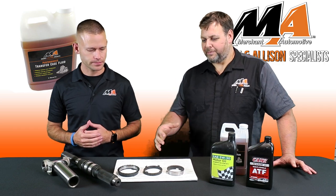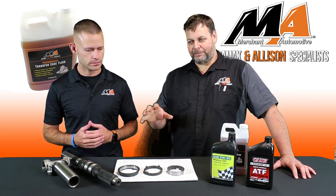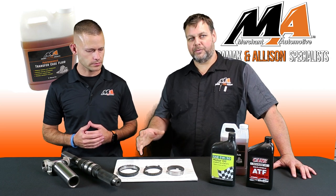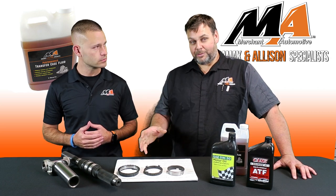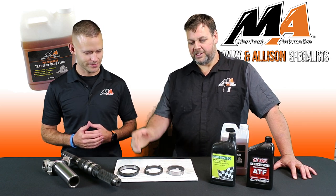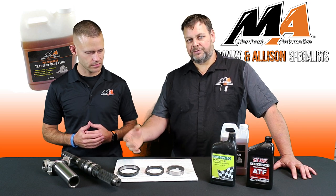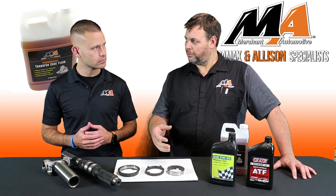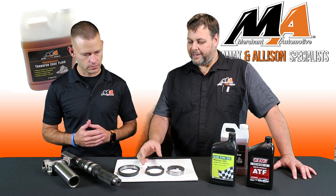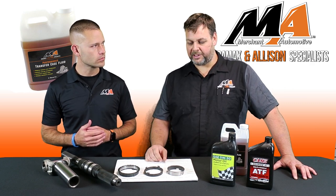Well, 5W30 is great for engine oil. A transfer case and an engine are very different machines. A lot of moving parts in an engine, a lot of moving parts in a transfer case. One thing a transfer case does have, especially the modern ones, is friction material, and the friction material is used as synchronization for engaging in high range and low range and that type of thing. That's why you're able to engage four-wheel drive when driving down the road in a modern transfer case.